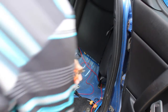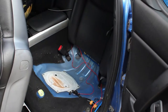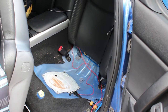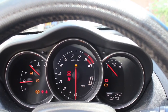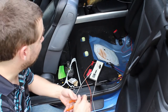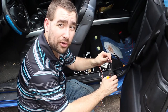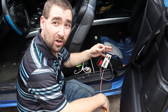If you can't get it right the first time, get it right when you can. So I'm going to go down here and snip the fuel pump lead and try this one more time. Let's see if I have proper dash indication. What I have here is just a plain old breadboard with a single MOSFET on it, already wired up for everything I need. I'm going to splice it into the fuel pump line and see what happens. This is not a heavy enough gauge to run the fuel pump full time, but I'm only going to idle the car and test that I have pressure control. This is not a good looking setup for going on the road — all I want to know is if this works.